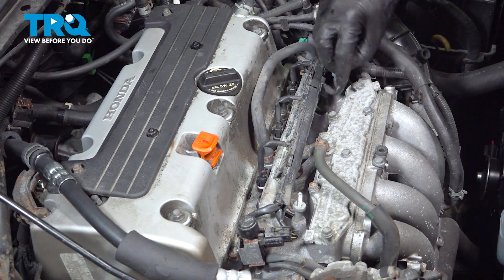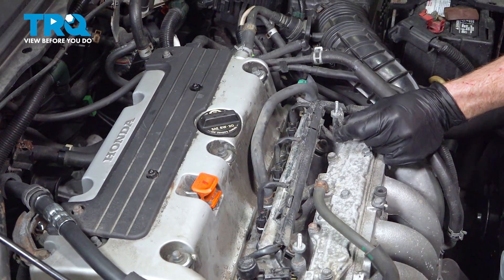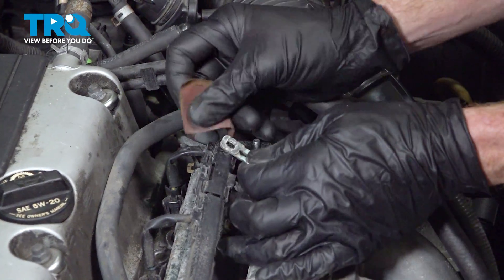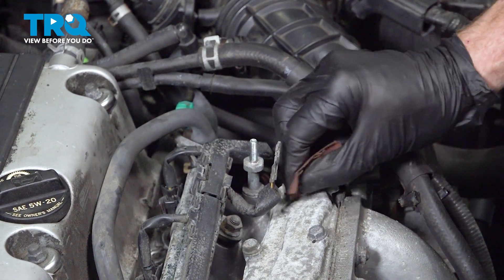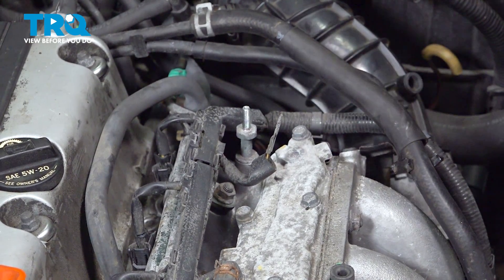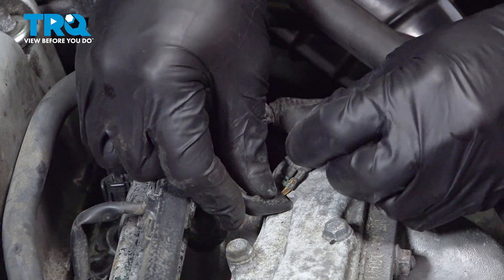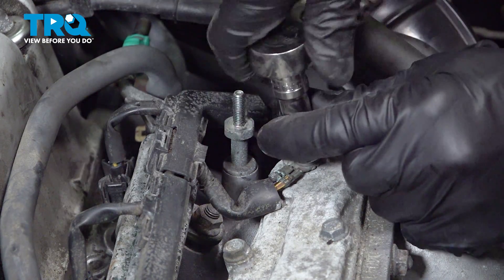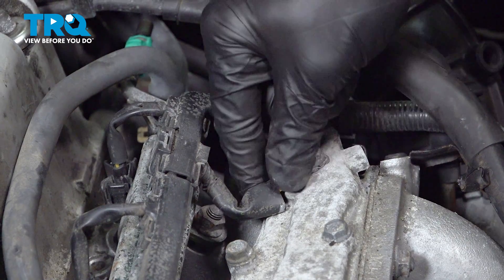Now make your way over to the ground wire. Pay attention to the intake and to the wire itself at the connector — look at both sides and ensure it's clean and free of any debris or corrosion. Give it a quick sanding with some sandpaper. Do the same to the intake along that contact point — we want good contact. Get it into position, align the mounting bolt holes, start in the mounting bolt, and snug it up. Make sure it's nice and tight using a short ratchet — you don't want to break it, just make sure it's tight to the intake.